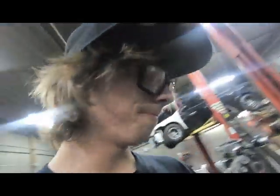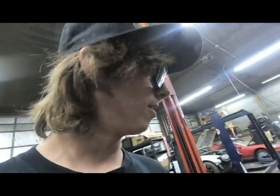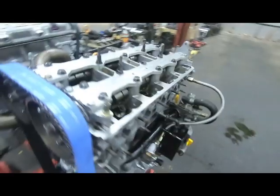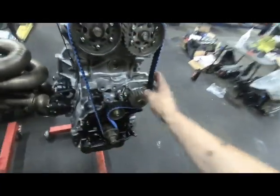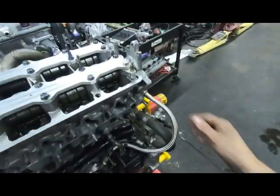All right, so I got the K-series all done, burped and pulled it out. I think I'm gonna go ahead and just double check the valve lash, make sure everything's good there, and that thing's gonna be set to go home. The CRX is super close - Jordan came by with a little battery tray today. We just got to tie that thing down, make sure the battery's secure. Once the battery tray is tied down to the weight plate it's not going anywhere. He just kind of had this piece already made and brought it, then built this today - it fits around the battery perfectly. We're gonna put some little tabs off of it and then just bolt it down.